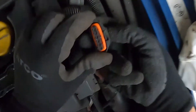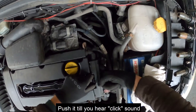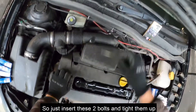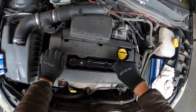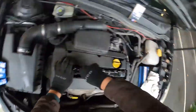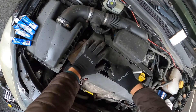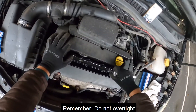Now just plug this connector back into its place. As you're pushing down, it lifts one side, so just push it down and push it in until you hear the clip sound — then you'll know it's secured. Now take those two screws from earlier, insert them and tighten them up using the X40 bit. Make sure it's tight enough but not over-tight.